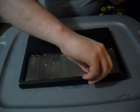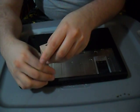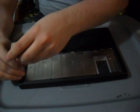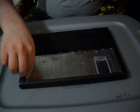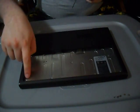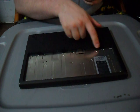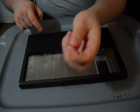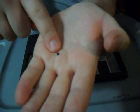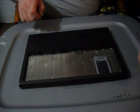Out of these 12 screws, there are only five that need to go in specific places. The two larger ones go on the outside of the case. The other ten are inside the battery case — four right here and the three in the middle are all interchangeable. The three tiny black ones at the very top of the battery case absolutely have to go back into those top three spaces.